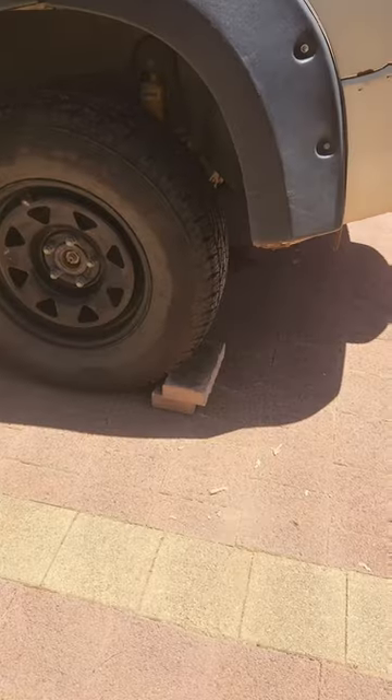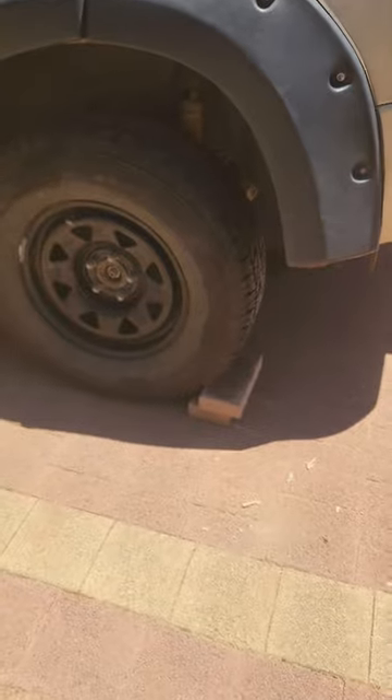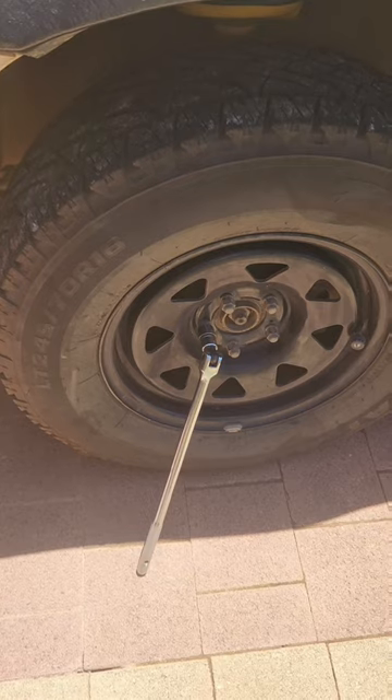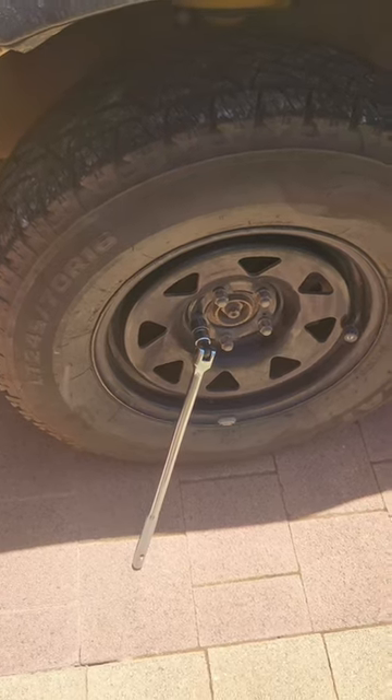So we did do it. What we did: I made sure the handbrake was on — that holds the back tyres in place. You also have to chock your car. We put bricks behind the front tyre we weren't working on and the rear tyres. The car's still on the ground, lowered. Make sure you undo the lug nuts on the tyre you want to work on, just so the wheel doesn't spin when it goes up.